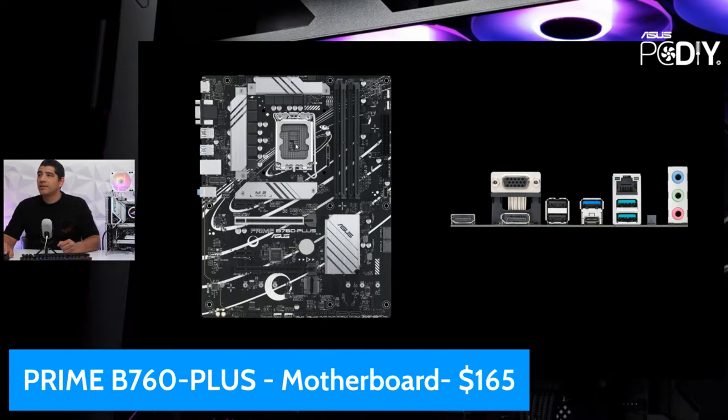So you are essentially going to have, of course, DDR5 specification. We already did have a DDR4 base model, but DDR4 and DDR5 pricing has definitely come down to be quite a bit more competitive, and it carries the benefit of, especially in multi-threaded performance, the bandwidth that DDR5 offers is quite a bump up for multi-threaded applications. Plus, you can easily get much higher densities, where you can run 32, 64, 48 gigabytes in DDR5. And now, with the latest generation non-binary memory kits, you could literally be going 192 gigabytes. So if you're a professional user with very, very high memory density needs, you wouldn't be able to do this on DDR4, but you could do this even on a motherboard like this in DDR5.